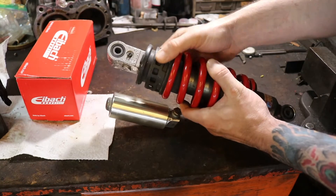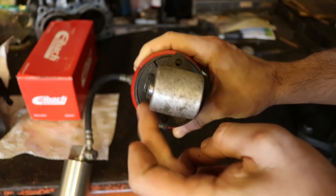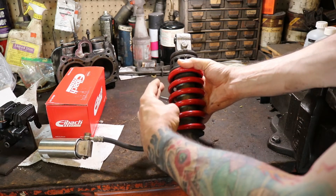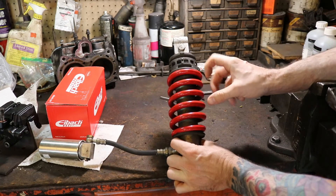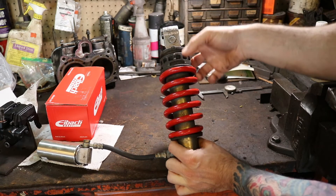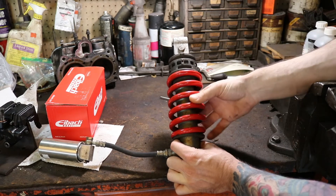On this shock there's an adjustment up here, and on the very top there are two plates — you can see them separated on either side. Basically, how this shock comes apart is you need spring compressors: little tools that go on either side, hold onto the spring, and compress it down. That compresses the whole shock down, releases the pressure on the plates up top, and allows you to take those plates off. Once the plates are off, the adjustment part slides right off the end and the spring can slide off.